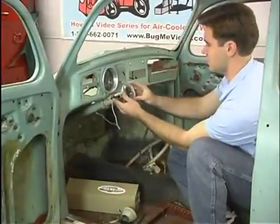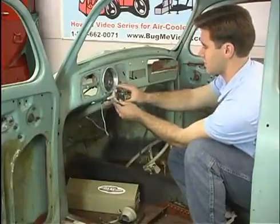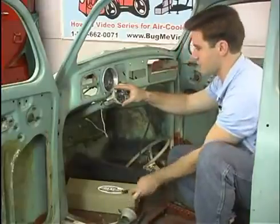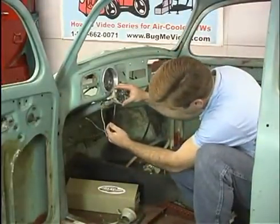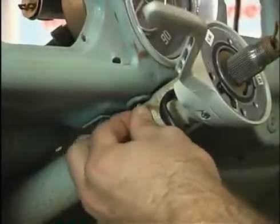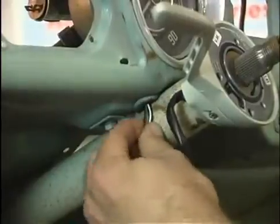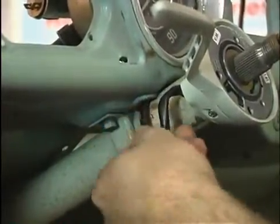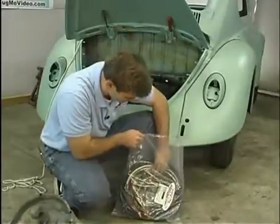It goes on just about the same way the other one came off — slides over into place. Make sure your arm is parallel with the bottom of your dashboard, and this has a Phillips screw. Feed the wires in one at a time so you've got them all up in there, straighten them out a bit, guide them through, and push the wire loom through. Now we'll get the wires out that we're going to be using in the back.